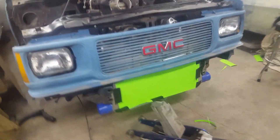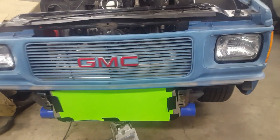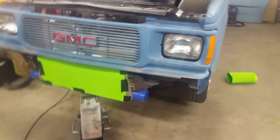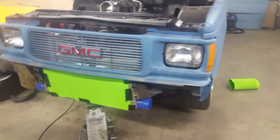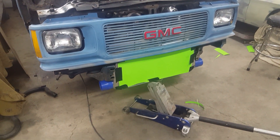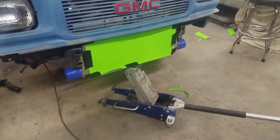Now I've run into another issue. With the grill on, it doesn't fit; if I move the intercooler down so the grill fits, it might be too low. So I'm going to have to cut the radiator support a little bit to give extra clearance to move the top of the intercooler in. Also a tip — on this cheaper China-made intercooler, the fins are very thin, and if you barely press on them they start to bend. I taped some thick cardboard on to protect the fins while I work.